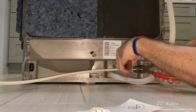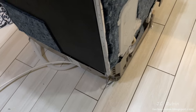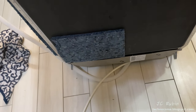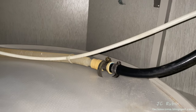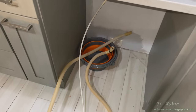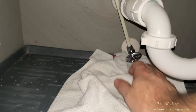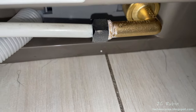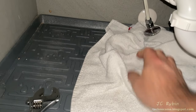The routing is correct, but the new drain hose is permanently affixed to the machine, so it will have to come out. My connections under the cabinet have been disconnected from the C-clamps, and I've pulled the old drain hose back and reconnected my hot water line, which I will temporarily test for leaks. I inspect all around the fitting and everything looks dry, so I continue by shutting off the water.